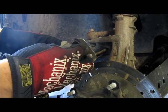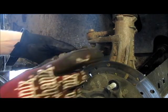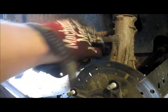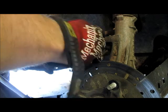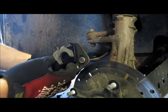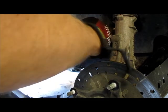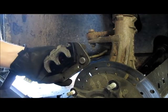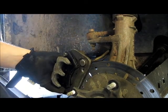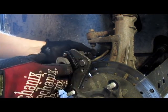And you wanna make sure that when you're putting these pads on, you've got them parallel, because if they're at an angle, when you're trying to put them onto your slide pins, you're just not gonna have any luck. So you're gonna pull it back out, which will lock the pads in place. That way you know that they can't slide anywhere. And then you will press it back on with the insert in the back. So we'll go ahead and do that real quick. And that'll ensure that the pads don't fall off. So just go ahead and put that back into the rear.